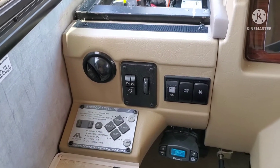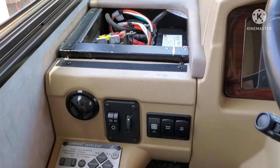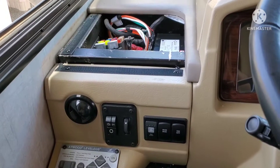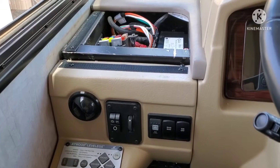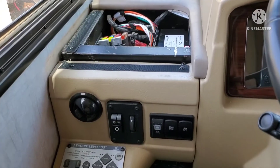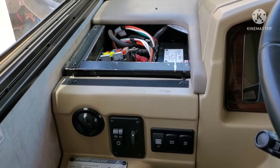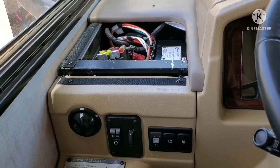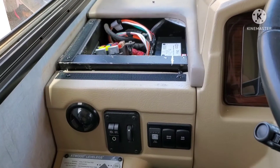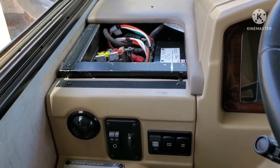His suggestion was to check my main power line and find out if there were any problems with it. I really didn't think I had any problems — this is a pretty nice RV and I've owned it for a few years with good maintenance. But every one of these systems has a main power line coming in from the battery. Directly below my battery is a 50-amp breaker, and the power line comes from the positive side of the battery, drops down to one side of the breaker, goes to the other side, and comes up through the coach into the control panel.